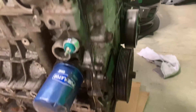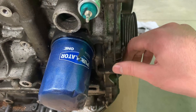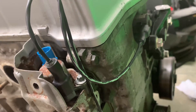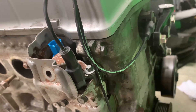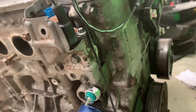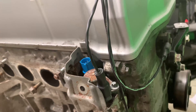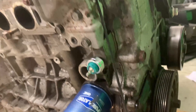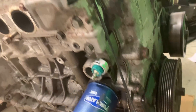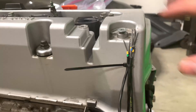This is the VTS, VTC, and CKP sensors - they're all wired in and look pretty good. I'll get some OE zip clips for this area and this area. The lines I drew with the Sharpie indicate where I'm going to put some shrink fabric on it, which I'll show later - it's a really good abrasion resistance to keep things from wearing through. DR25 is a very tough shrink wrap, but it never hurts to have extra protection, especially if you're racing the car or making a harness where connectors are joined and harder to replace.